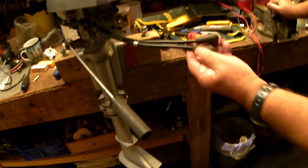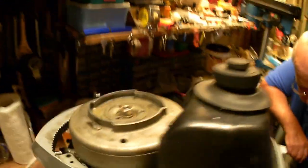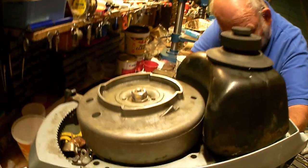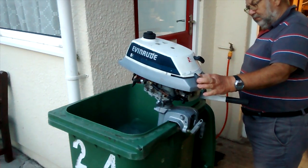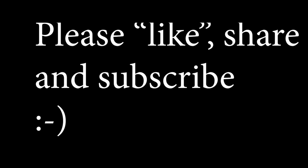Same length, but we've tagged it so that's cool. Brand new spark plugs in, set to 25 thou. We've got to put the top on so that this mechanism will work and we can pull it to start. Then the camera batteries ran out, so we put the top on, put some fuel in, put it in the water, and this is the result. Thank you to the Admiral for helping me out with this one, and also thanks to you for watching all the way through. Please do give it a thumbs up, a like, a share. I hope I've been helpful — bye bye now.